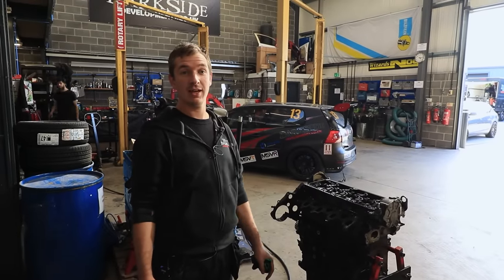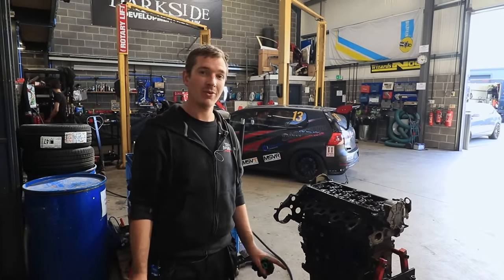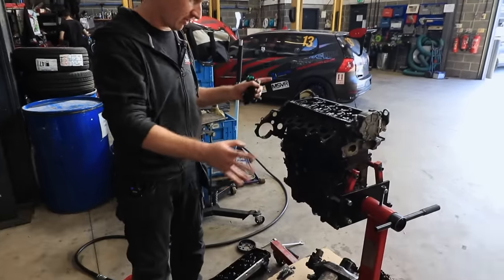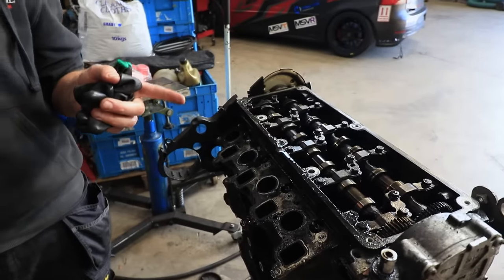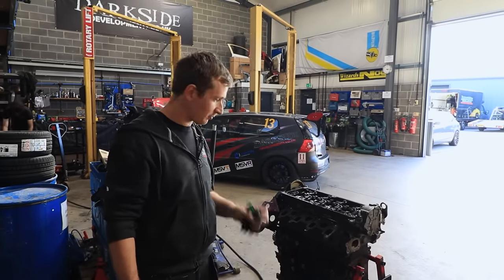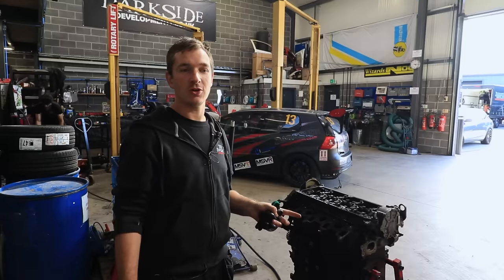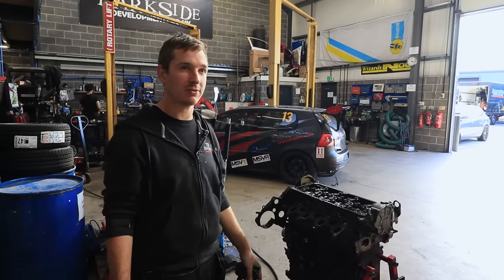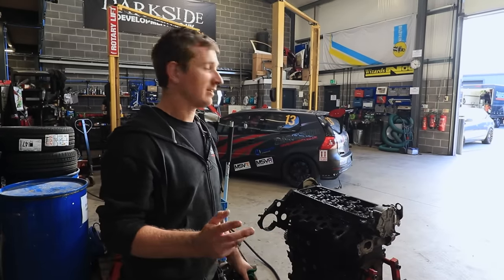Another little vlog, hopefully a bit more informational than anything else. What you see here in this horrible crusty mess is a CFCA engine — this is the 180 bi-turbo from the Transporter vans. Absolute painful engine; we hate them when we tune them because they never make power. If you're at 150 horsepower standard you're doing well, and if your engine's not dead for the reasons we'll talk about in a bit, you're doing even better.